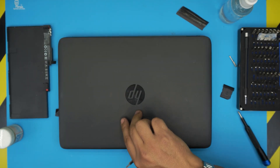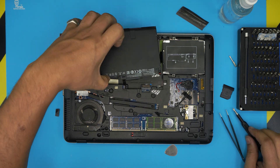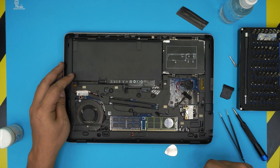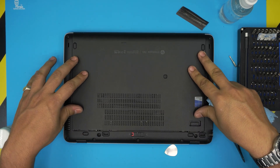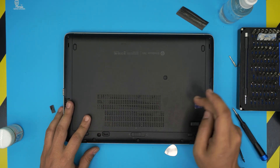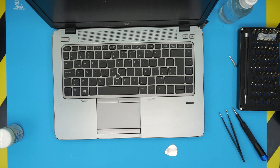Close the laptop down and flip it back upside down. Tighten up the two screws for the keyboard. Then grab the battery, slide down the front end, bring it over, push it in, and lock it in place. For the bottom cover, clean it up outside first, then bring it in at an offset position, slide it in, and push it toward the back end to lock it in place. Place the SD card reader caddy back in, and that's how you do your own service and maintenance for the HP EliteBook 745. I hope you liked this video — thanks for watching and I'll see you in the next one.